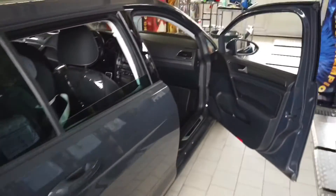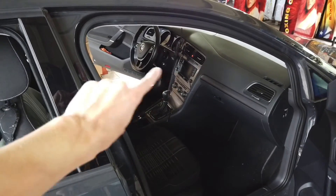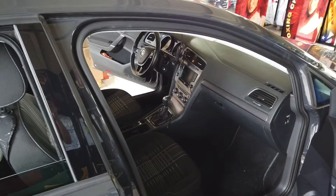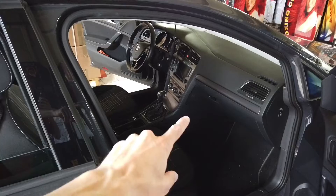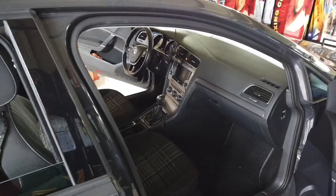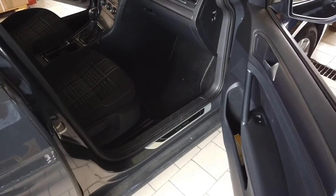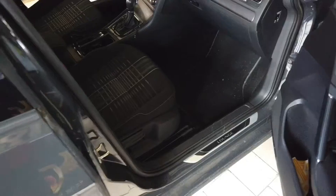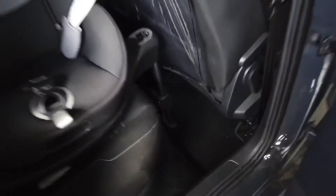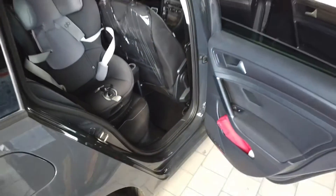To install this I will have to tear down some of the plastics. The BCM module is on the driver's side, close to the side, so I will have to take out some plastics from the center console and remove a few things to guide the cable to the right side of the vehicle. If there's enough time and I have the correct tools, I will also guide cables to the seats, because the back row illumination is installed under the seat. There's a hole where you need to push the light in, but you have to guide the cables first. Let's get to it.